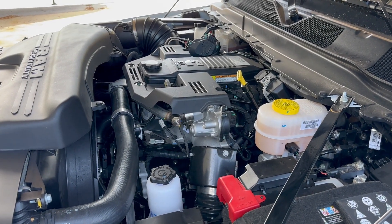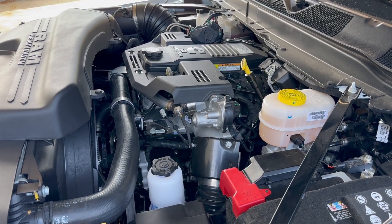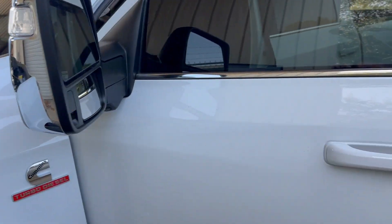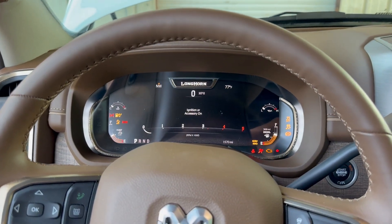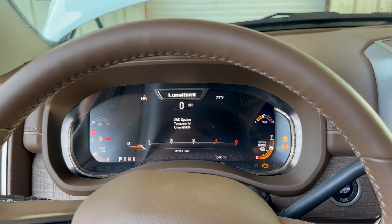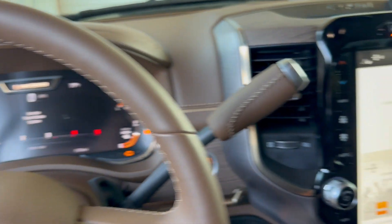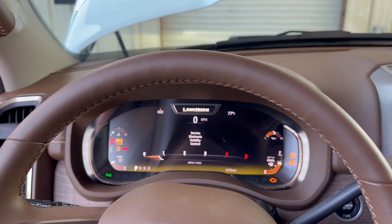So that wraps up the PCM swap. Something that fought us a little more than normal on this one is a power steering line. If you want to avoid the hassle we just went through, go ahead and remove the intake horn all the way. Side note: when you hook the batteries back up, it may take a moment for everything to sort itself out. So go ahead and make sure you've got the key in here, turn ignition on. We have not cleared codes on this, so there'll be a bunch of stuff that needs to be set. It's just got to sort itself out. The good news is it runs — it's happy. The PCM swap is almost completed.